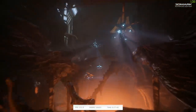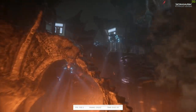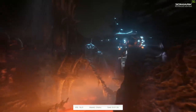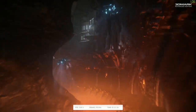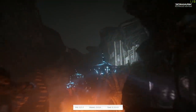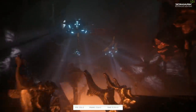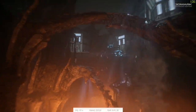So now that we've differentiated these devices, let's see what the BirdDog can do. Here is an image from my PC running over HDMI to the BirdDog, which is pushing it out via IP to my TriCaster. This video is running at 1080p at 60 frames per second, though my TriCaster is currently recording at 30. It's nice and crisp and clear — I'm not seeing a lot of the compression artifacts that we typically see on the Spark with these kinds of game capture. I'll put up a bit more footage in a few minutes to give you a better comparison.